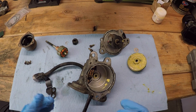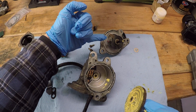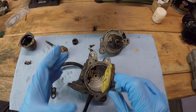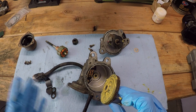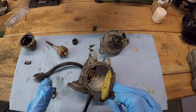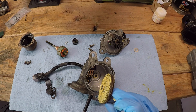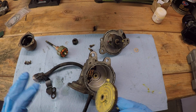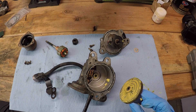I took a lot of pictures during disassembly because this gear needs to be in proper orientation with the piece containing the clock spring — those two need to be in time with one another. When I took it apart it was in the unlocked position, so on reassembly I need to maintain that unlocked orientation. I may need to do a little calibration once reassembled, but for now I'm concentrating on cleaning everything up and making sure there's nothing obvious keeping this mechanism from working.